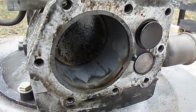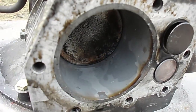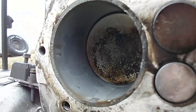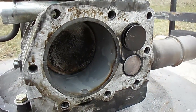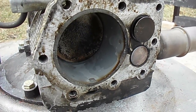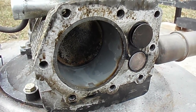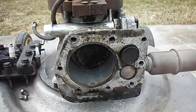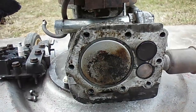I'll wipe that oil out of there — you can see all the way around it. The way it was running, my guess is the carburetor needs some adjustment. It was kind of fluffing there; it wasn't quite the right mixture from the sound of it. It wasn't really backfiring, but it was doing something — you can tell from the sound it was making in the video. But anyway, it looks like the JB Weld cylinder actually survived the run.